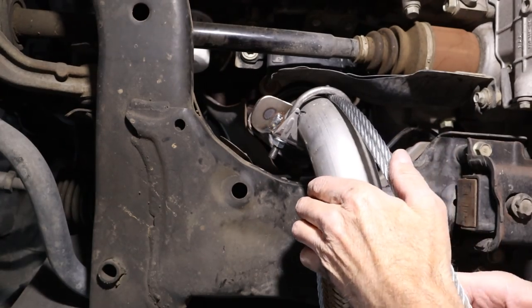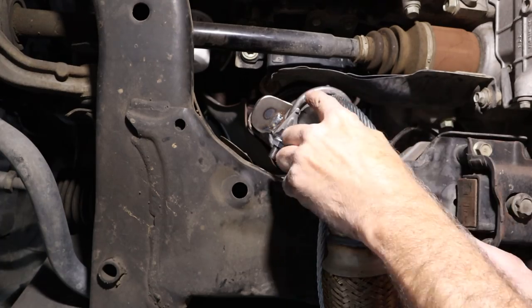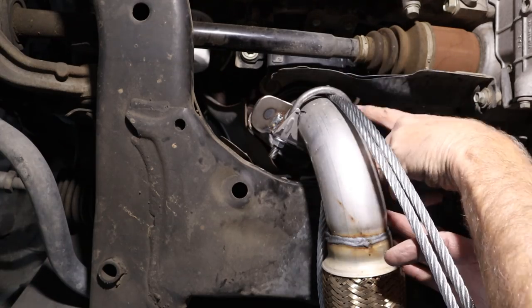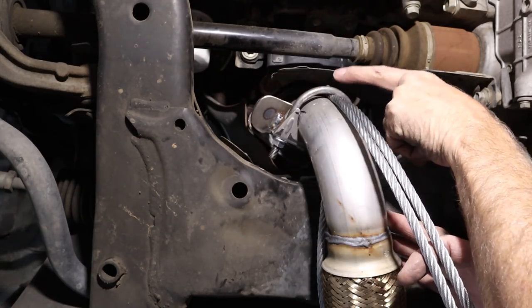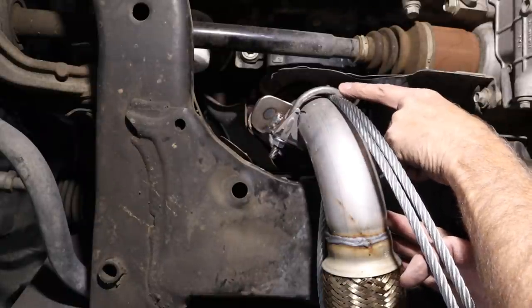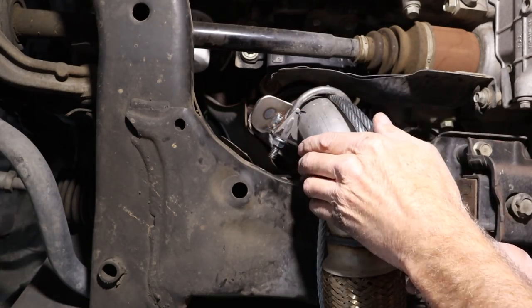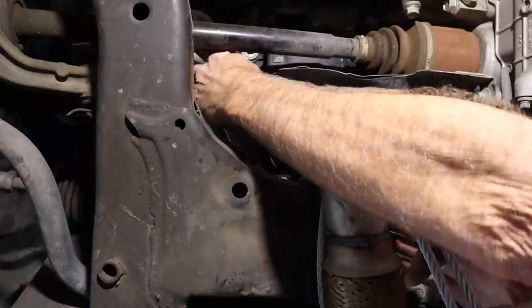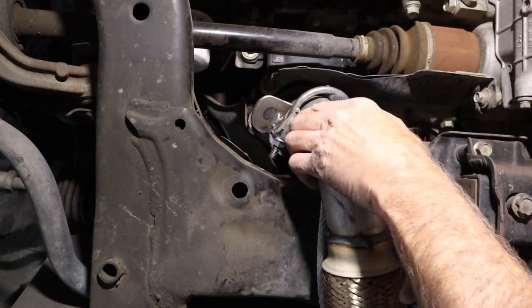And if anything needs to be done on the vehicle service to get this piece off, all you have to do is just take a Sawzall, cut it right here, just bend those out of the way, or cut it in two spots and get it out of the way. And then all you'd have to do is replace this U-bolt right here. Piece of cake, you know, $4 or $5 at the auto parts store for one of these. So that's the best I can do right here without blocking the O2 sensor and a bunch of other stuff. And you can still get your hand in here and get to the oil filter as well. So that's on there really good.